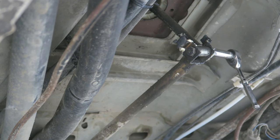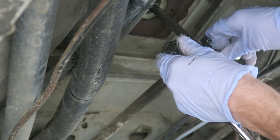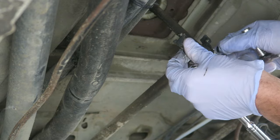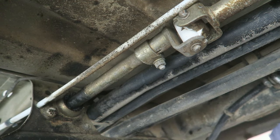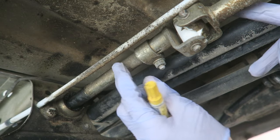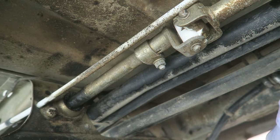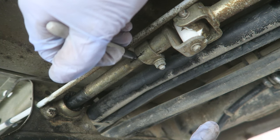Go ahead and release the shift fork from the shifter — it's just a 13 and a 10. These things are super loose. Those four 10mm bolts are super loose. I guess you just got to barely snug them up. Here's the other end of the shift fork — it just has a 13mm nut and bolt on it. I'm going to go ahead and mark the alignment where these two come together. This is like midway through the car. The gas tank's right up there. I'm going to do some alignment marks so I know where this thing goes back together.